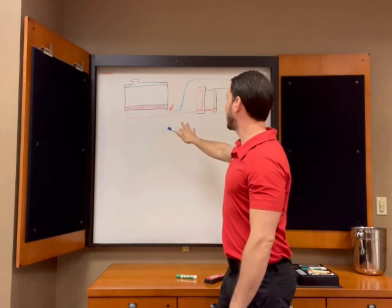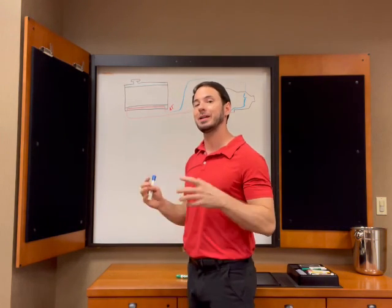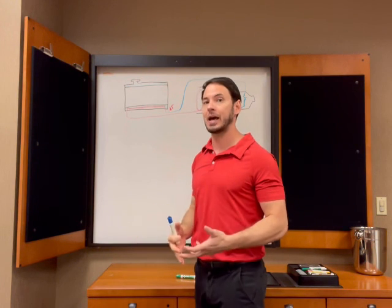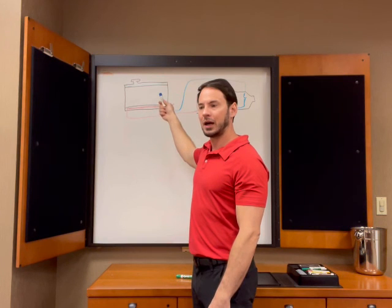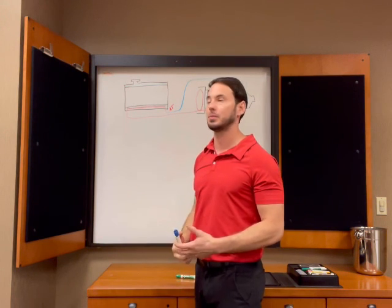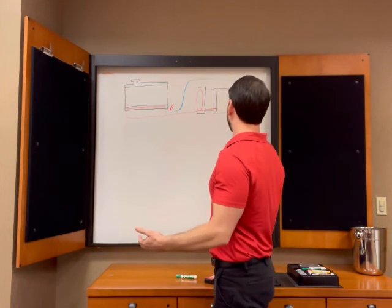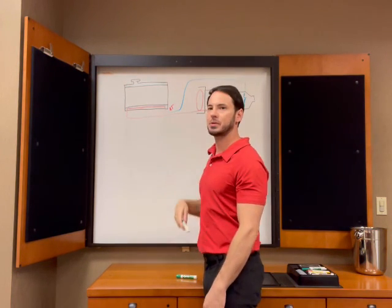So in that way, here we don't have a cooler. What we have is a liquid to liquid heat exchanger. This is a temperature stabilization device. It's not a heater, it's not a cooler. You can call it either because it does that function depending on what it is. I generally don't call it a cooler anymore because I think it just confuses people. So cool, we've got that. We understand what we're dealing with here. So great, you're thinking, okay, makes sense, right? I'm going to stabilize my ATF temperature with my coolant temperature.